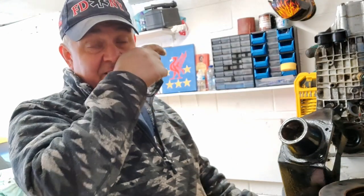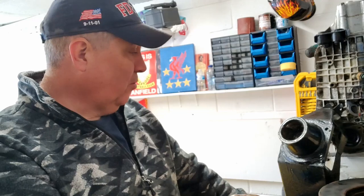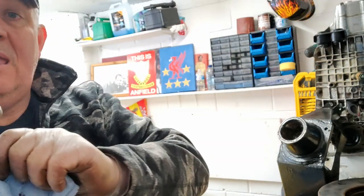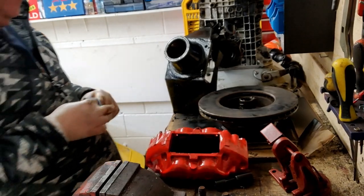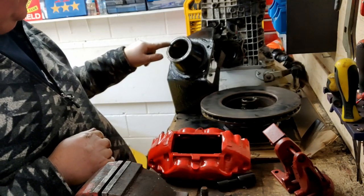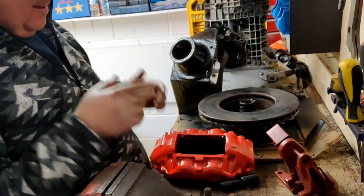Back again. What I'm going to be doing today is rebuilding the rear driver's side suspension so I can put the wheel on, move the car from one side of the garage to the other, and then slip the far side down and start working on that side. I've trial-fitted this so I know it's all good. There's the upright resting on the gearbox and all the component parts. The disc looks manky from this angle but that's just oily fingerprints - it'll all be cleaned with thinners before it goes back together. The upright's all been painted, filled with fresh grease, the bearing in there has all been scrubbed, chemically cleaned, and filled with fresh grease.